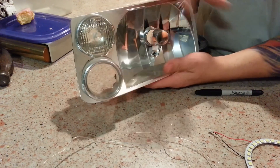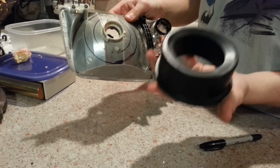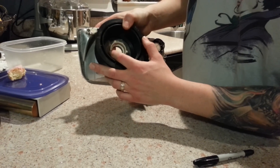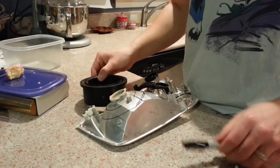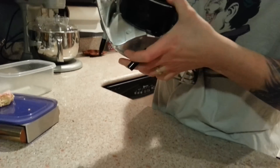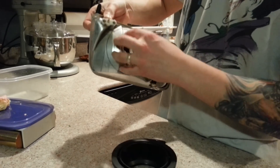What I got here — I've taken my headlight apart so the front shroud and the back headlight bucket is off. Turn it around — you have your coupling here, this is what's going to house your projector. You're going to place it on top, look at it from the front and from the back. Make sure it's completely spaced properly so that, looking at where the OEM bulb goes, there's even spaces on either side — top, bottom, left, and right. Then you're going to take your Sharpie — I've already done this — place your coupling on top, mark the inside. Once you know it's completely set, mark the inside and hold it in place using hot glue or any kind of tape.